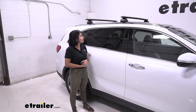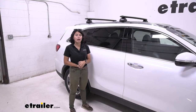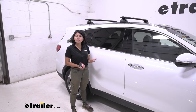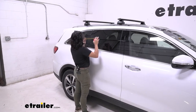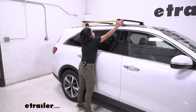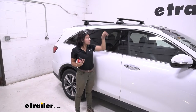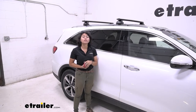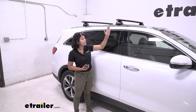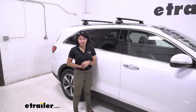What impresses me with this one is the ability to move the crossbars wherever I want them to go — that's not usually something you would find for a fixed mounting point vehicle. Here I have it set to 34 inches, which is where the backs of the mounting holes are in the flush rails. You can move it forward up to 36 inches if needed, which is where the end caps or top caps are on those rails.